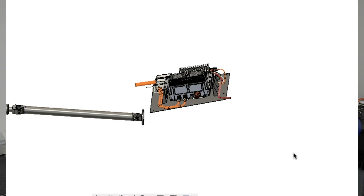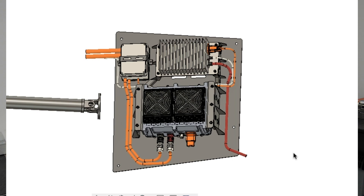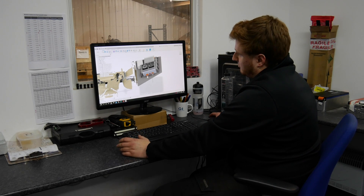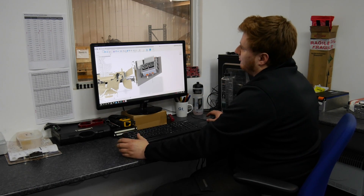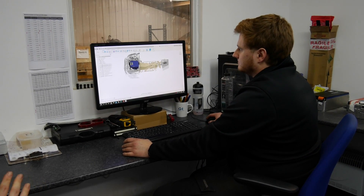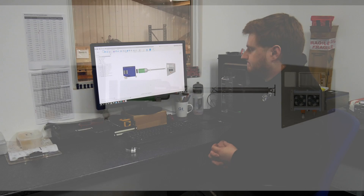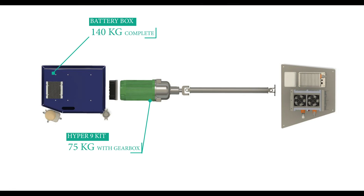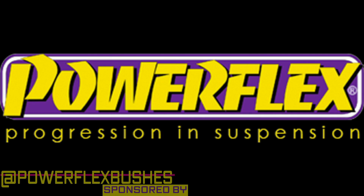It also tidies the look of the front end, so it's just going to be one nice battery box and the BMS - really tidy. The battery charger, DC-DC converter, and a little junction box all have captive nuts so everything's easily accessible - no need for spanners or ratchets - and everything's removable from the top hatch behind the seats. In terms of weight: battery pack complete is 140 kilograms, motor, gearbox and controller is 75 kilograms, and the battery charger and DC-DC plate is 30 kilograms - giving us a total of 245 kilograms.